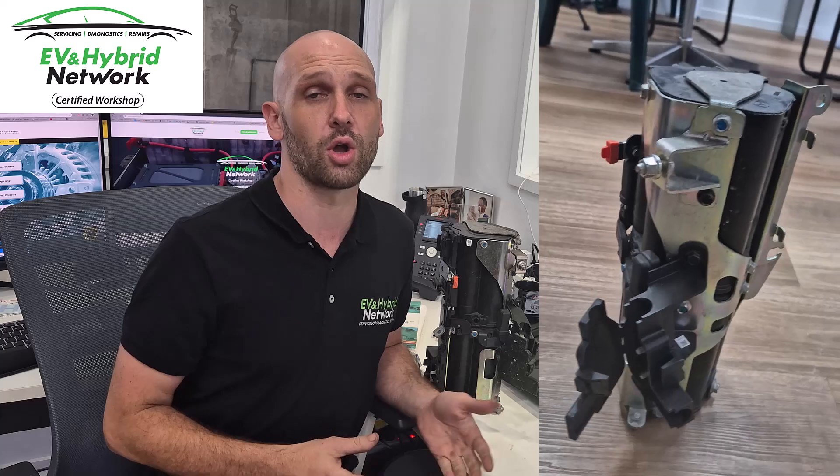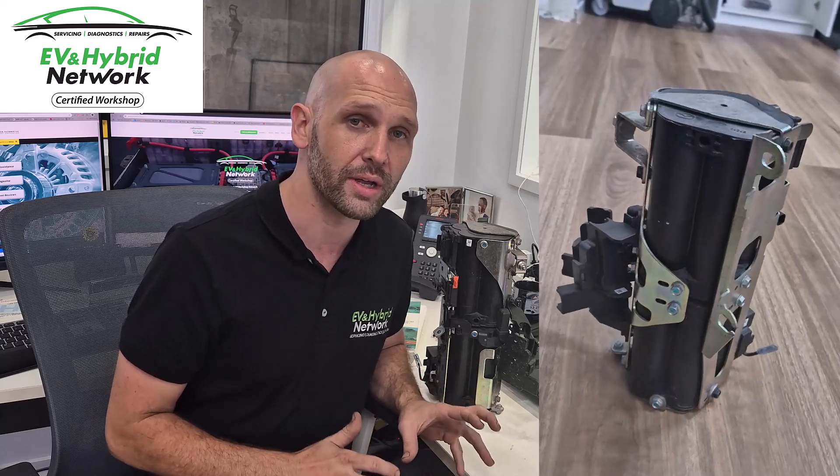A system that's been around for over 10 years now and is still on current models. It's what you would call a micro hybrid. As long as we stay below 60 volts DC — which is what the standard sets as high voltage, when we need EV tags on the number plates alerting first responders — technically we're not high voltage, but we still definitely have some hybrid-based functions. A lot of vehicles that people wouldn't even know are hybrids, and lots of Mazdas out there running this i-Eloop system. It's based on a 25 volt architecture.